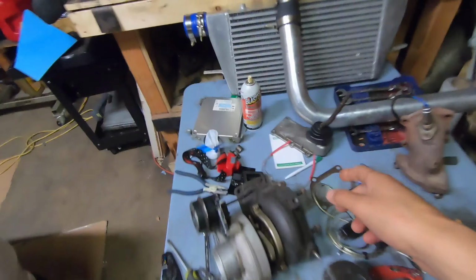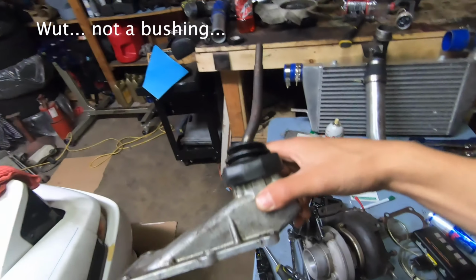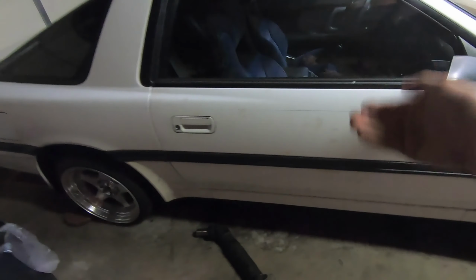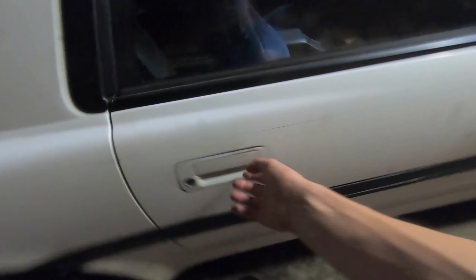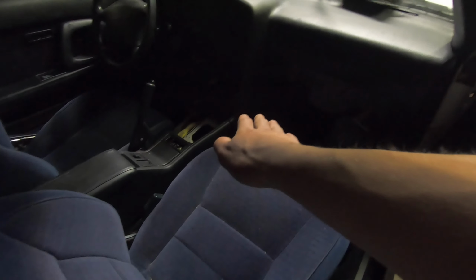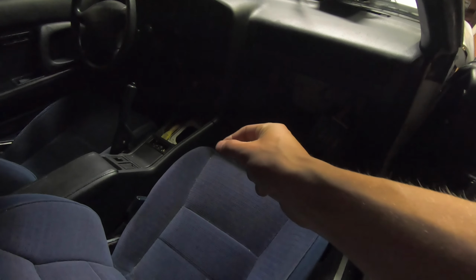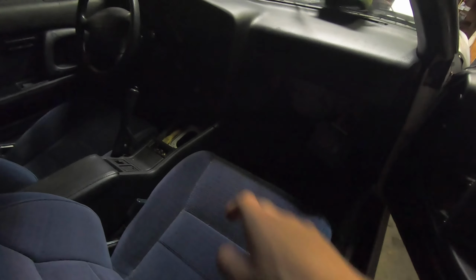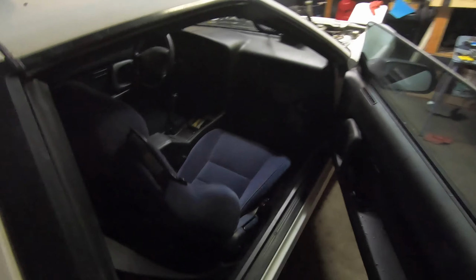this put on. This is the shifter bushing for the W58, which means I'll have to pull the crossmember mount down, lower the transmission a little bit, and then we'll kind of go from inside. If you can see through that hole, we'll slip the shifter in, place the ball where it needs to be so it sits in the actual shifting linkage, and then we'll bolt everything down from there. There's a gasket that needs to go around there as well.